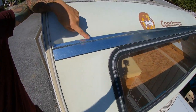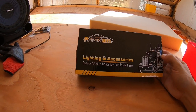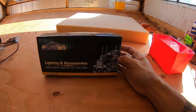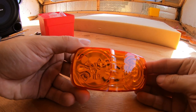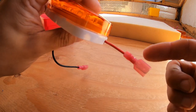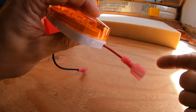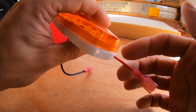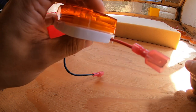It's been a few weeks now and happy to say that little gutter right there totally fixed the problem — no more water entry. Now it's about time to get these clearance lights installed. Picked up these lights on Amazon; seems to be the going trend with a lot of people who are doing conversions. They're pretty inexpensive and they are super bright. I installed these connectors right here, which I probably should have done after the fact, because now I have to cut a hole that's accommodating for the connector instead of something smaller for just the wire.